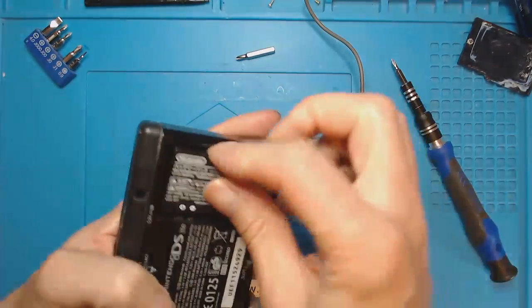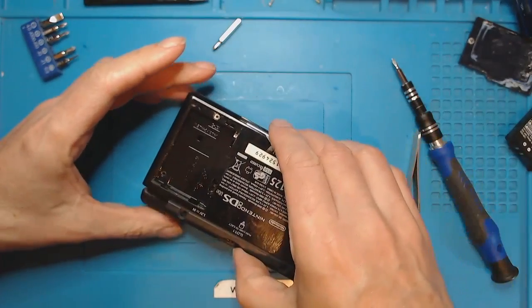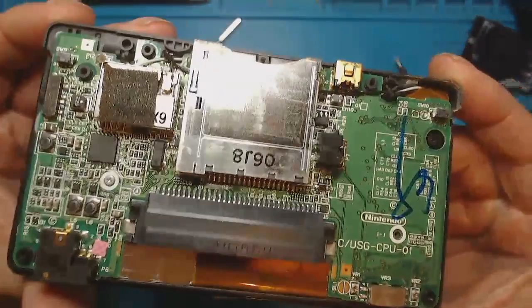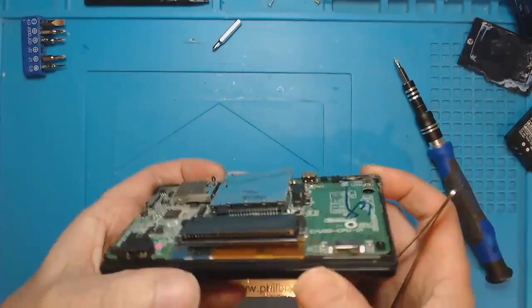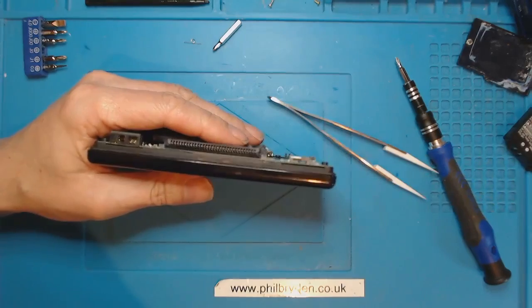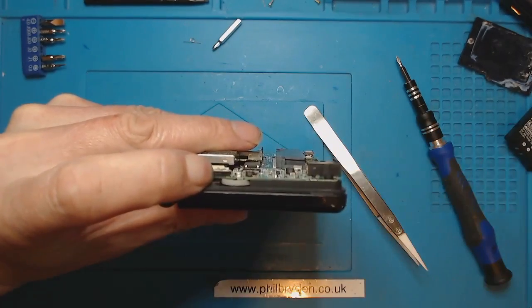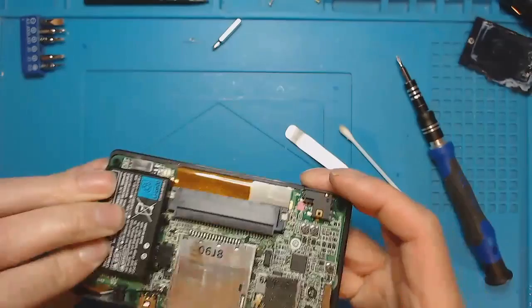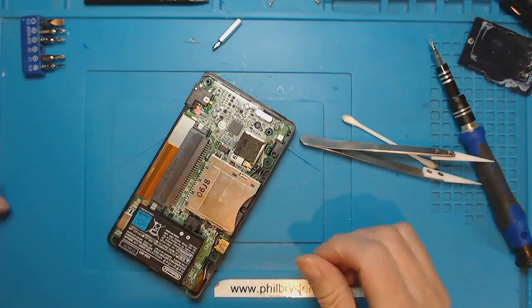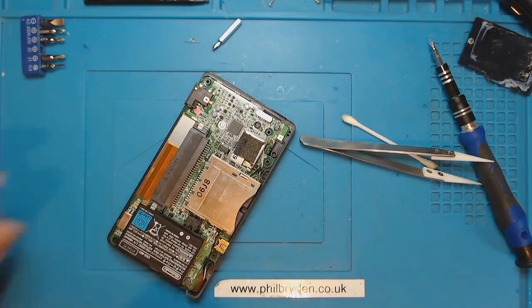This one I'm about to open - the black one with the battery installed - the orange light will stay on. That looks quite nice but there's some water damage. The first thing I'm going to do is put a little bit of alcohol in that switch. That doesn't seem to be the switch, so I'm going to test for voltage at the switch. Where's my multimeter gone?